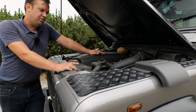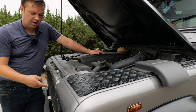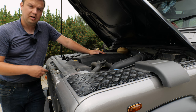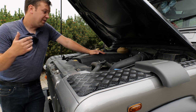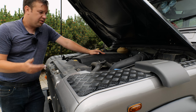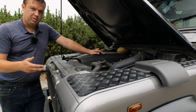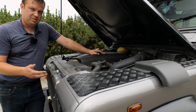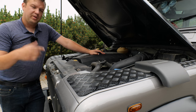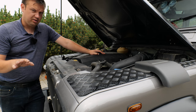I was saying that the 2.2 and 2.4 like their cooling system, so you want to make sure that the rad and the air conditioning condenser and the intercooler are all clear of any mud and debris. But honestly, they're pretty reliable engines as well. The drivetrains and Defenders are really quite robust, so you want to make sure it just starts, idles, drives well. Fuel filters are important on those newer engines, as well as the DPF systems fitted to the later 2.2s. Make sure that it's all functioning well, or possibly have it tuned off, but that's not something we can condone.